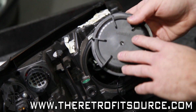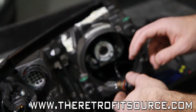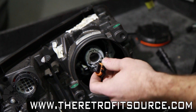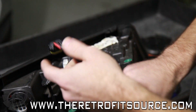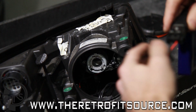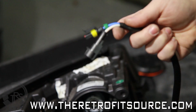With that, we're actually not going to drill a hole as we usually would, but we're going to plug everything directly in. Start by removing the original halogen light bulb from the power pigtail that powers it. We'll plug that directly into the standalone CAN bus harness, and then directly into the ballast to provide power. From there, we're going to install the light bulb, and the outputs from the ballast will go directly to the inputs on the bulb.